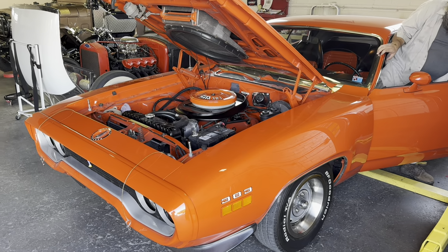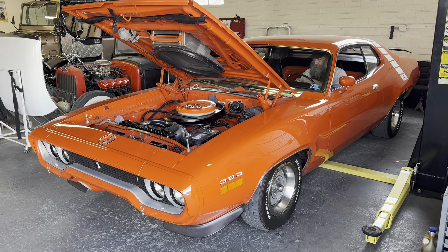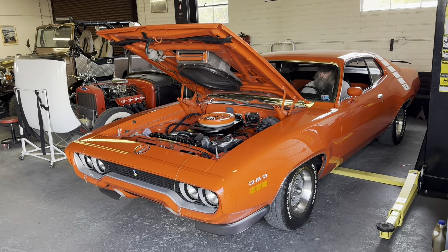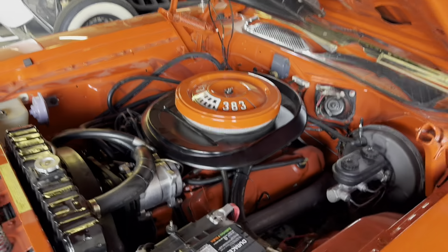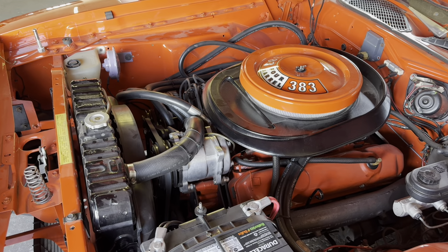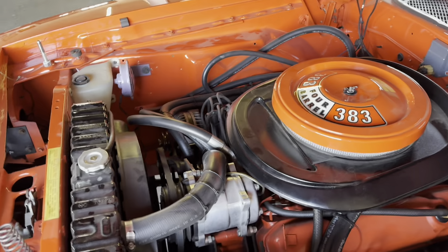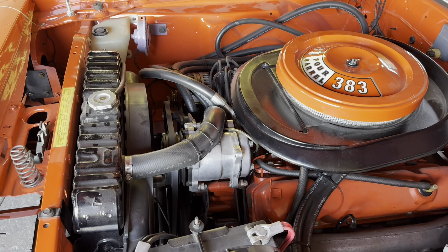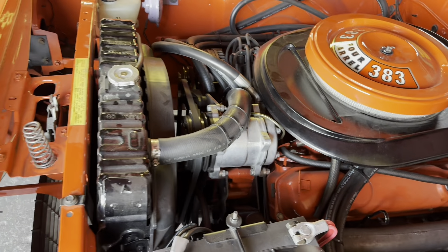Alright, having them fire this up so I can see how it cold starts. That fired right up - there's a belt squeal, but that's the good old Edelbrock with an electric choke. It only has one AC belt - since it's an aftermarket retrofit kit for a non-AC car, they put an idler pulley on to make it all work. Triple lower pulley: one for the alternator, one for the AC, one for the power steering. Starting great.